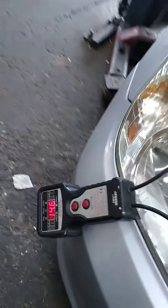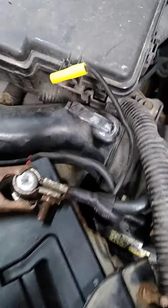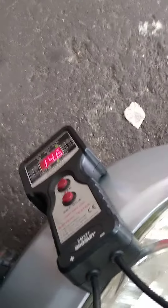This Honda Civic alternator and battery redo job with fixing burned up charge wire — we got an impressive charge here with a brand new battery, brand new alternator, brand new charge wire. We also found some hokey work: the aftermarket ground had a heavy gauge ground going into the outside of the transmission, and that's not good. You don't want to ground through your transmission clutches, Honda bond, all that. It needs to be grounded to the engine block, so we went right to the exhaust manifold, which is right to the engine block, and this thing is more than happy with that.